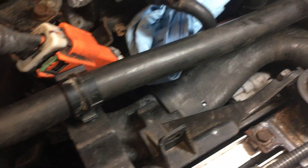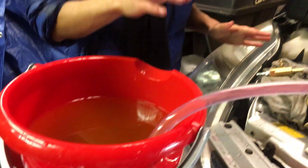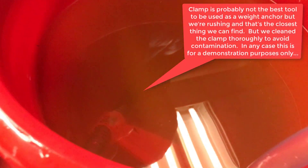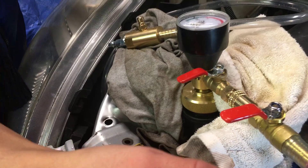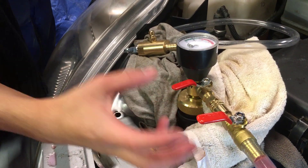This is a good way to check if your hoses are all connected correctly and don't have any leaks. So we got the coolant hooked up. There might be a bit of bad air bubbles because we actually put a clamp at the bottom to keep the bottom half submerged. However, it doesn't matter because we're going to bleed the system anyway. But in an actual refilling, you want to make sure there are absolutely no air bubbles. When you have it hooked up, you pull this back and put the hose in. Make sure both of these are closed so nothing gets out, then release this so they're secure.